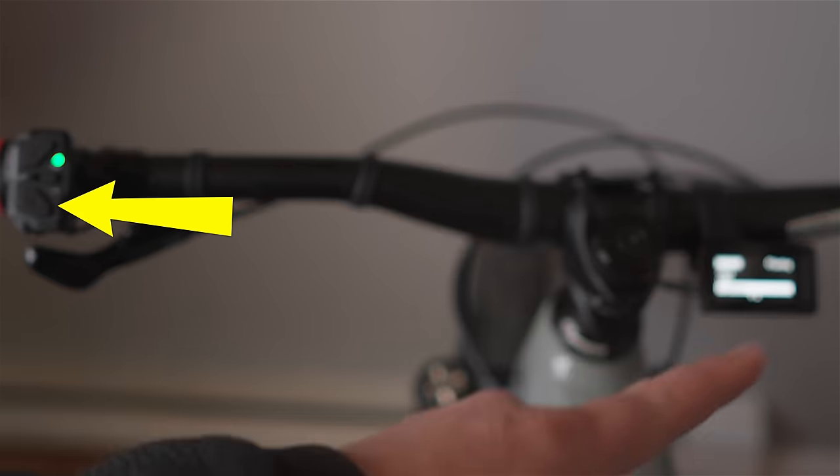There's not much difference in maintenance compared to a regular bike. There's no real maintenance you do to the motor, and the battery just stays in the frame. One thing I heard is you don't want to leave the battery fully charged if you're going to let it sit for a couple of weeks — drain it down to about 80%. Also, you don't want to leave it plugged in all the time; when it's fully charged, unplug it. That should give the battery more longevity for its recharge cycles.